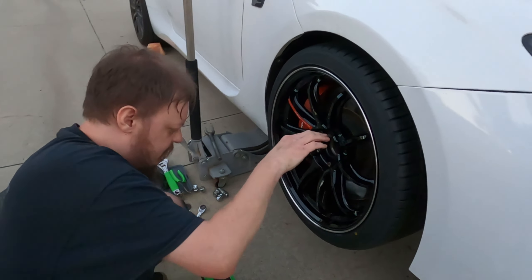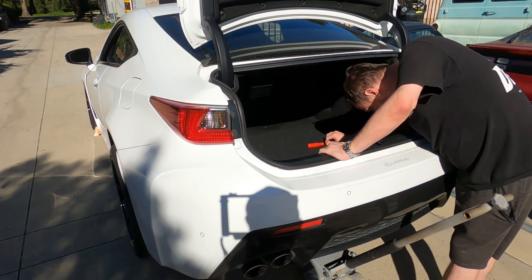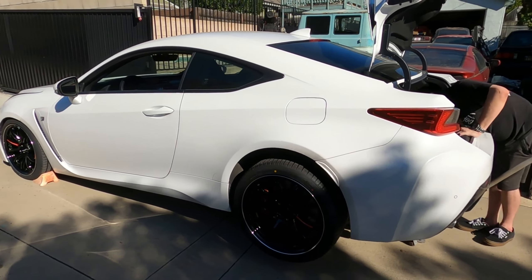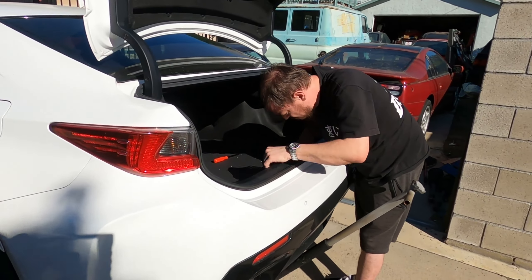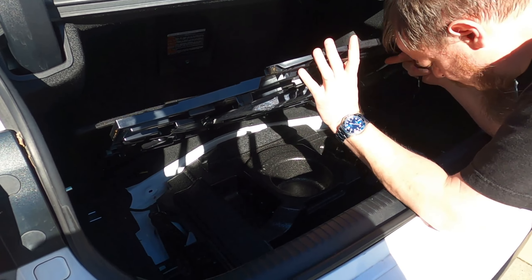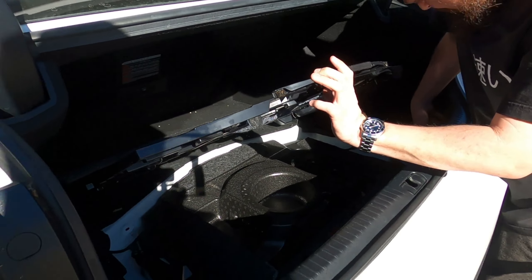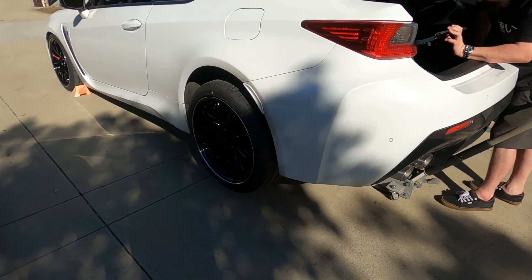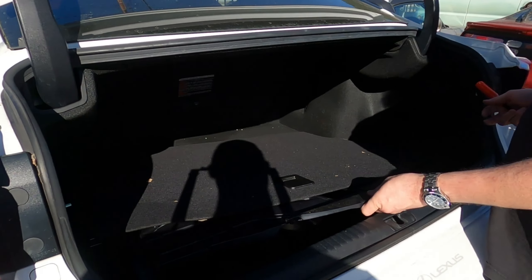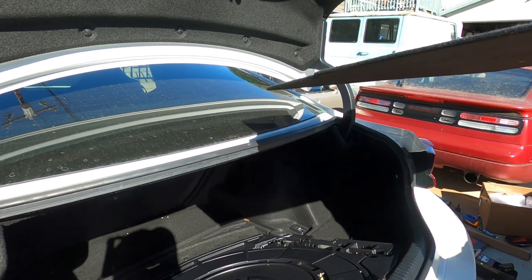The Silvers logo didn't even move once torqued to 80 ft-lbs. Now we're continuing on to the rear coilover install — it's actually been a pretty straightforward process despite the learning curve of removing the ball joint for the camber arms. We have the rear in the air. The trunk panels have to come out because we have extending adjusters for the dampening.